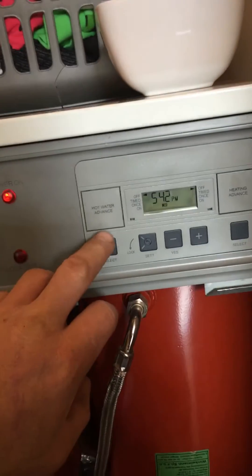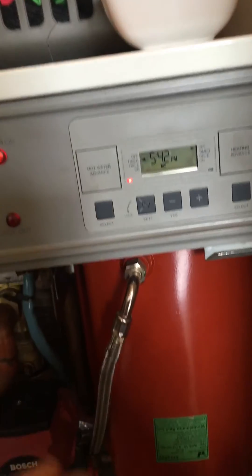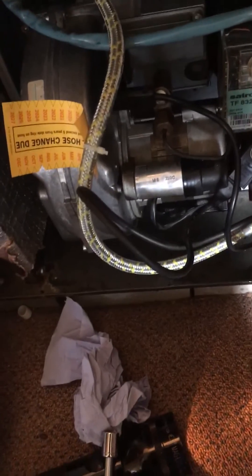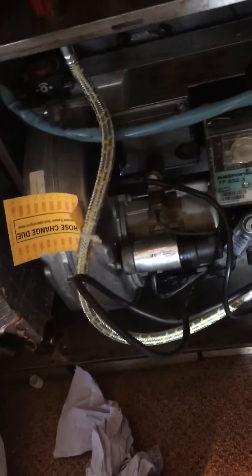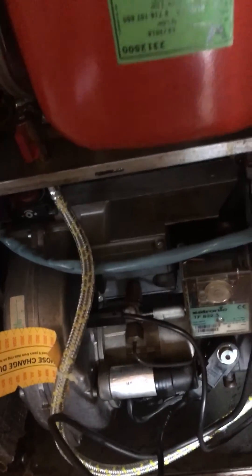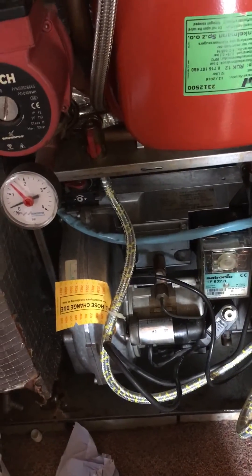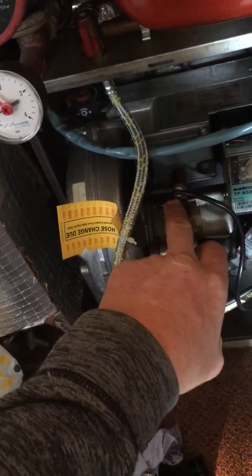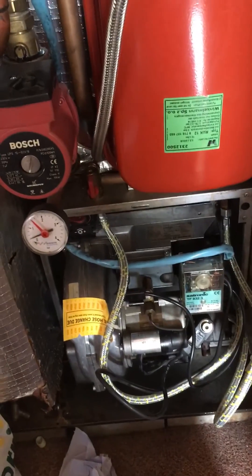So I'll go back onto this and press. It's starting up. It should fire up — you know you should get it firing up. And that'll be the fuel going in. You hear it firing up? You hear that? That's firing up right there. Boom. So you won't hear that boom noise until you've actually bled this nut, bled this system. Alright. Cheers.